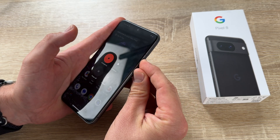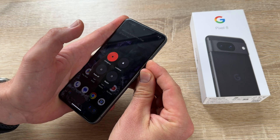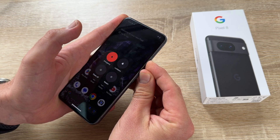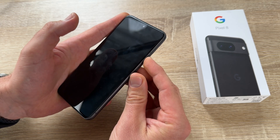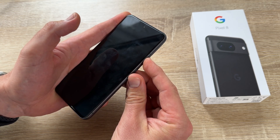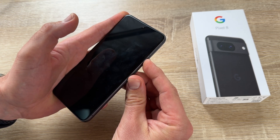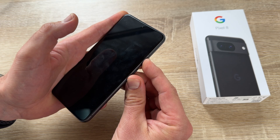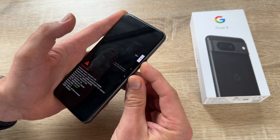Push and hold — counting through approximately 10 seconds. And here we are. Now change to power button and volume down. Keep pushing these two buttons until the device boots into the bootloader. This will take 10 up to 15 seconds. And here we are — we have entered the system.